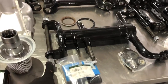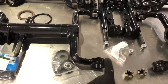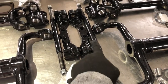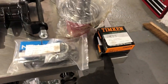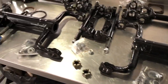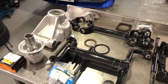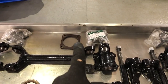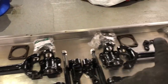I've been able to get to this enjoyable part where I can lay everything out and check that everything fits — start doing trial fitting. The fulcrum shaft here — making sure that it goes through the damper shaft. And the inner fulcrum shaft goes through here as well as through the distance tube. I've now been able to lay out wheel bearings inner and outer, the outer fulcrum shaft kit, the new inner fulcrum shaft kit, hub oil seals, the hubs ready to go along with the new spline shafts left and right, plus all the necessary shims.